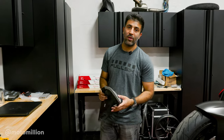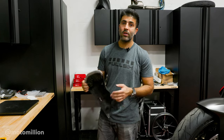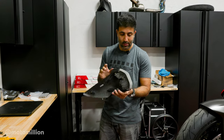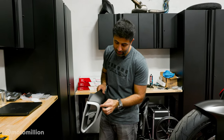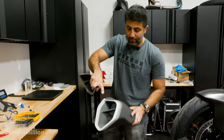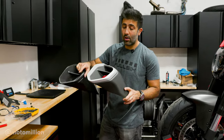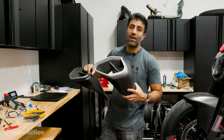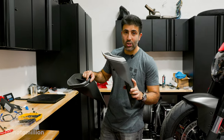Remember I said we're going to change a carbon piece for a carbon piece? It's our air intakes. I'm going to be very open and honest — this didn't have the best fitment. We actually had to Dremel some stuff and open holes bigger, and it always bugged me on how it fit. This piece is not even. The new piece will get rid of this aluminum piece in the front — that's probably what the problem was. It's really hard to get carbon to fit these two pieces correctly, and it's probably very expensive to achieve proper fitment.